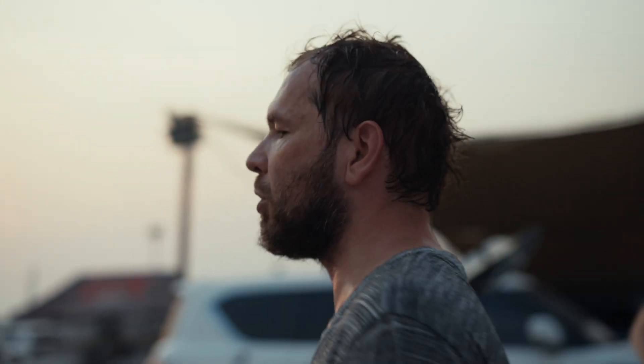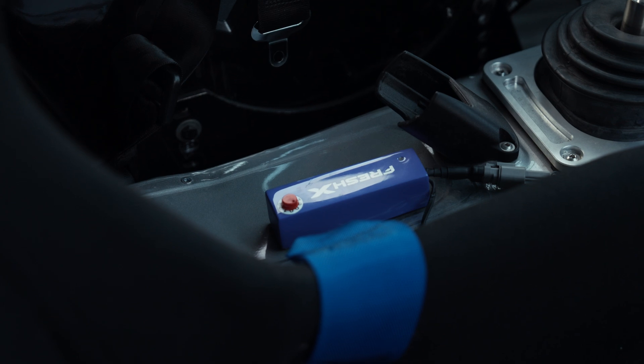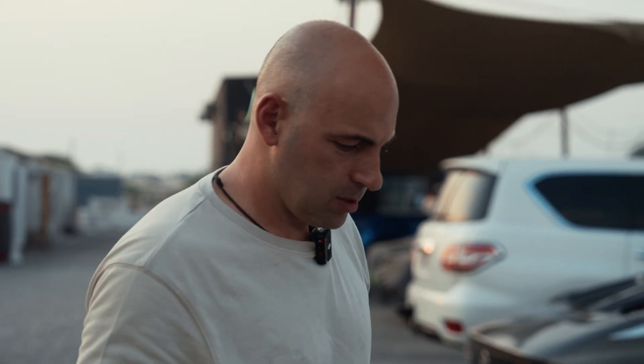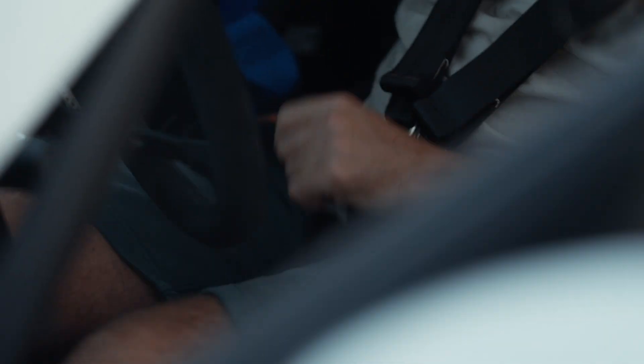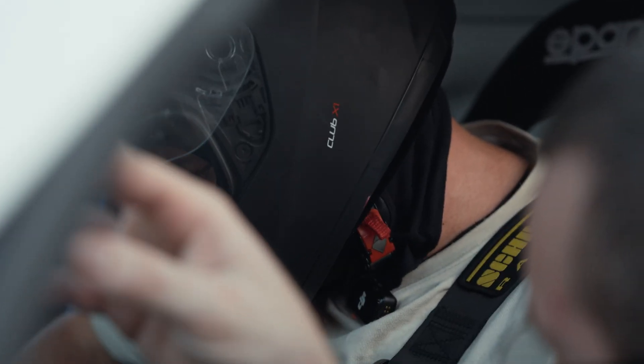Overall I kind of liked it — the only issue is the steering wheel is a bit too far from me, not comfortable to reach. Today is our test day; we brought out both Baby Z's. These cars are almost perfect — they only had one issue: in tight turns the steering would bind a little, and Tolia felt the wheel didn't self-center fast enough. I had no complaints about the stock hydraulic rack, but let's see if there's any difference. My Supra back in Russia has an amazing power steering setup with adjustable stiffness — best I've ever driven. The wheel feels heavier than before; there's a knob to adjust steering stiffness, though it takes about 10 seconds to change because the electric motor needs to spin up.